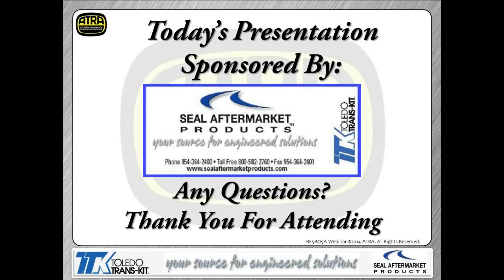When it comes to clutch end play on these transmissions, when they first came out, Lance and I actually worked on this for a few months, dealing with techs online to come up with the correct end plays. The problem was that several factory manuals were way off. The clutches were way too loose. We had all kinds of clutch and shift complaints related to the clutch end play. So we used factory information, some of our own. We looked at some of the ATSG information, Transgo, Ratio Tech. We compiled all that, and working with guys on the phones, we came up with this set of measurements that worked really well.